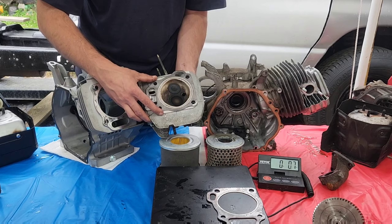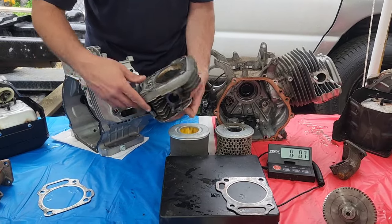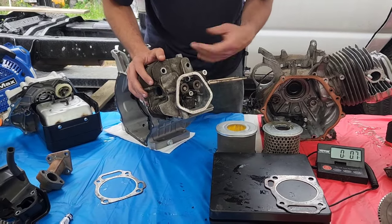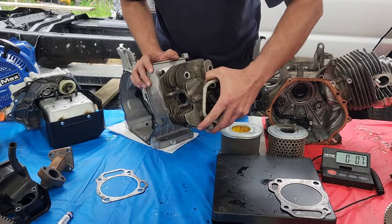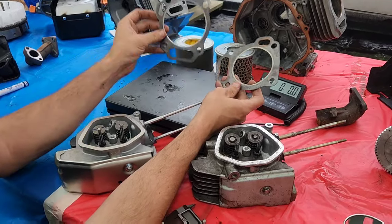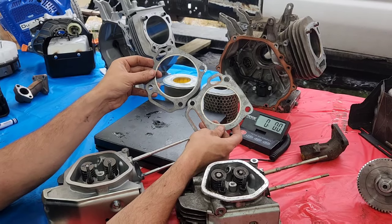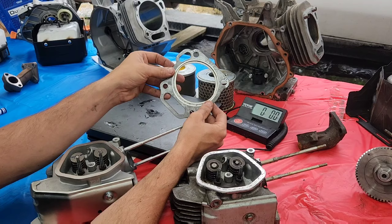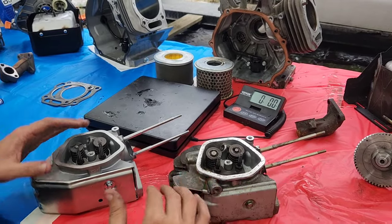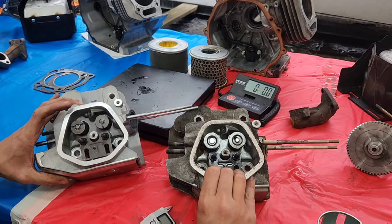Internet argument number 322: could you use a GX head on a Duramax to make a high compression head on the cheap? The answer is yes — it'll bolt right up. There are GX-size and Duramax-size head gaskets available. NRracing.com — who does not sponsor this channel but gets a shout-out anytime possible — makes the correct gasket for both applications. Now let's talk about the heads. The rocker standoffs are basically exactly the same — same sizes, same thread, same everything. But what's different is the valve caps: one has clips, the other has a cap that locks in.